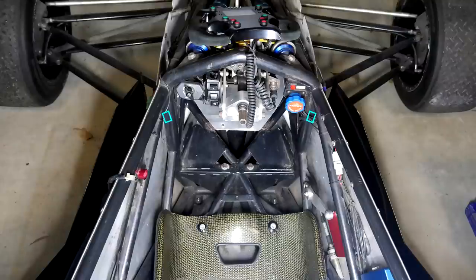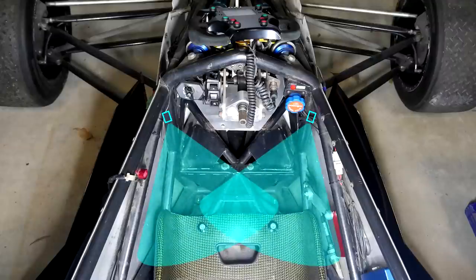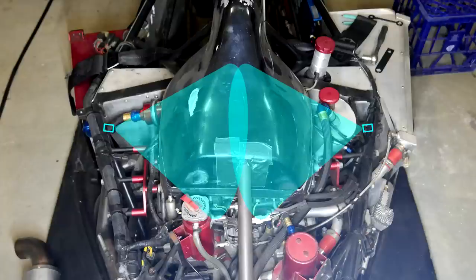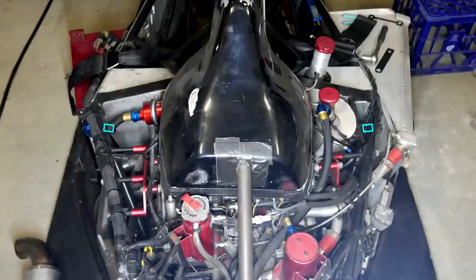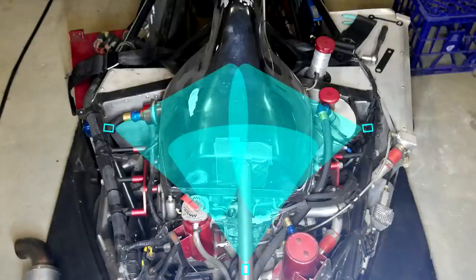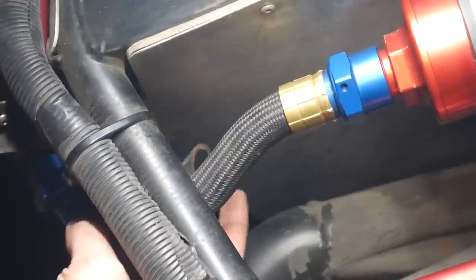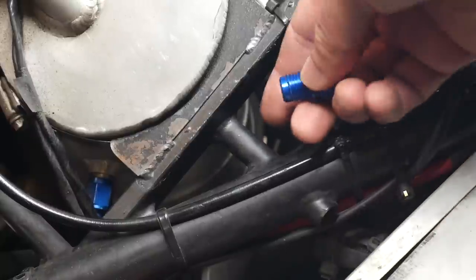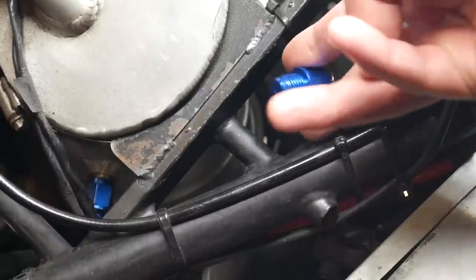In the cockpit I plan to add the nozzles to give a nice even spray pattern all over me, instead of just the engine bay like it is now. Around the engine, there are two nozzles on the very far left and right hand corners to provide reasonable spray over the exhaust and the sides of the engine. But the manual calls for a third nozzle, and I reckon the best place is on the underside of the structure that supports the roll hoop, so I can cover the other side of the engine and very importantly the fuel rail. There are already some nozzle plates welded into place, but the right hand side is a lot, lot harder to reach.